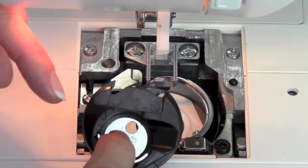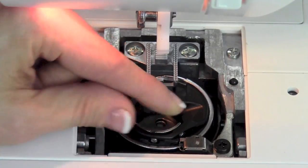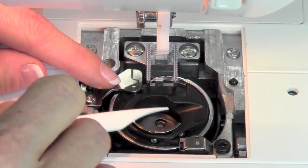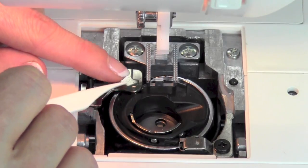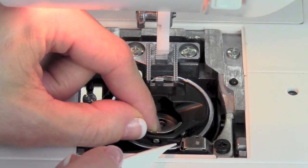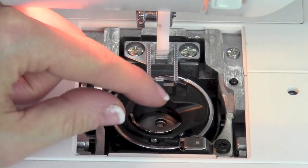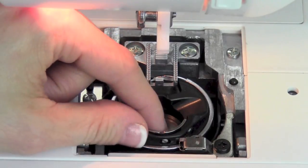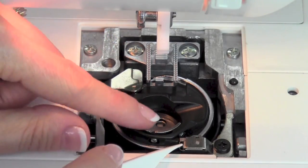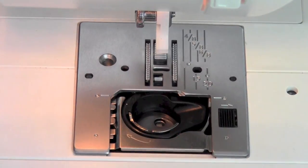To put this all back together, it is key that you get two places lined up. First off, these pointy ends — they go towards the needle. Once this is in there correctly, there's an arrow on the silver part and an arrow on the black part of the bobbin case; those need to point to each other. When those are lined up, you're probably also going to see the second part that needs to line up. Right down at the bottom there's a little heel — that heel is going to be on the left side of the spring. That is properly positioned; it has a little wiggle. There are so many times people get it in opposite of where that little spring is and it just doesn't work. Make sure you're on this side, look at those arrows, look at the little spring, and after you've cleaned it all out you're ready to assemble. That is all you have to do for cleaning — it's really not a lot of work.